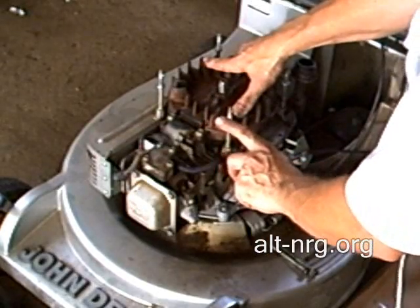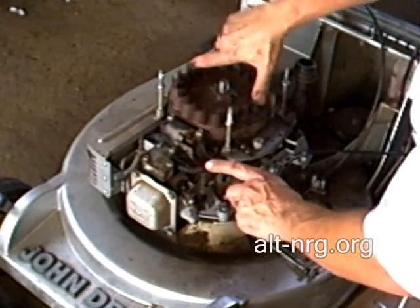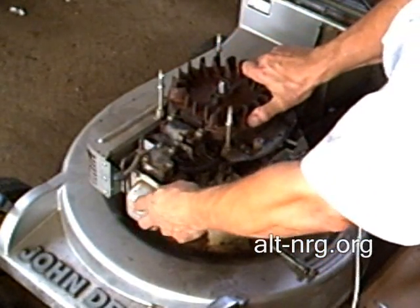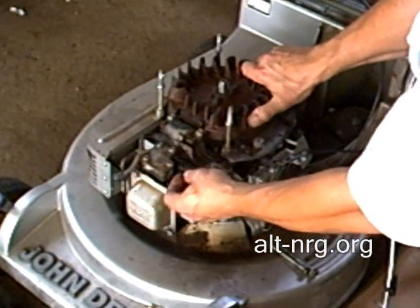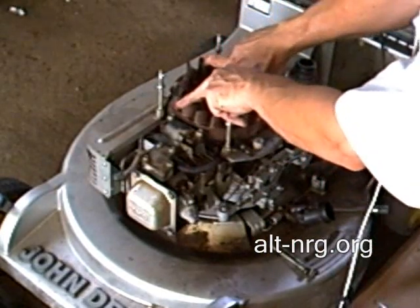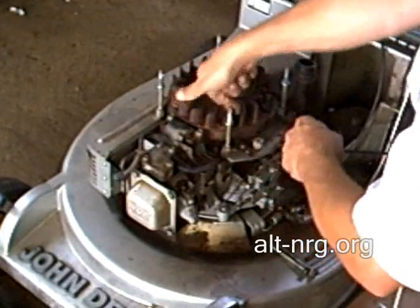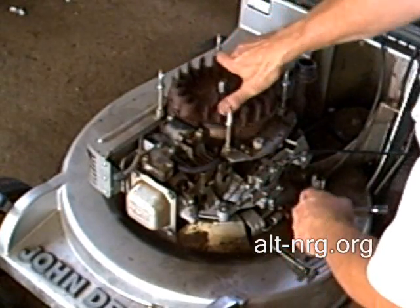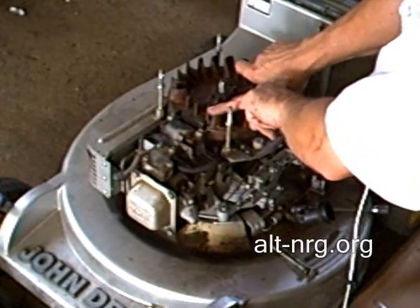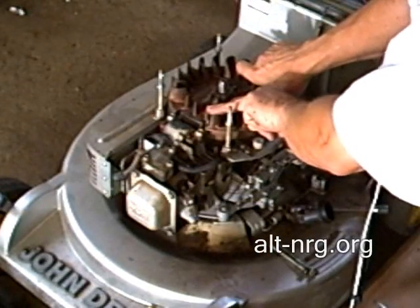This is important because on a power stroke, or on the compression stroke, when you want the spark, both valves are closed. The chamber is sealed, it has compressed gas and fuel in it, and it ignites and it provides power to keep the engine rotating in one direction. On the exhaust stroke, when it comes around to top dead center, well, I should say right now this is probably 20 degrees before top dead center, which is where it's timed for gasoline.